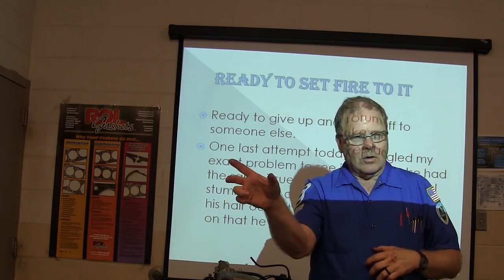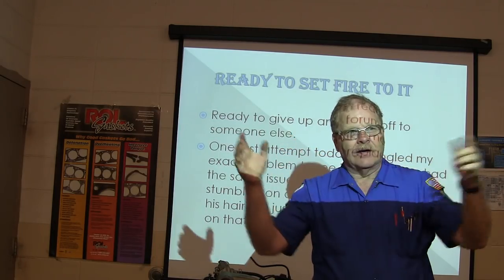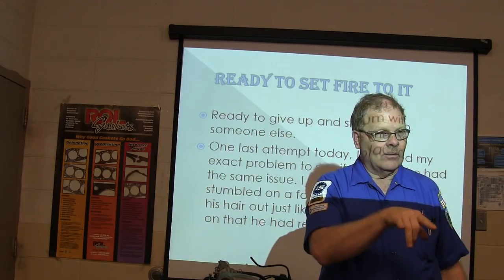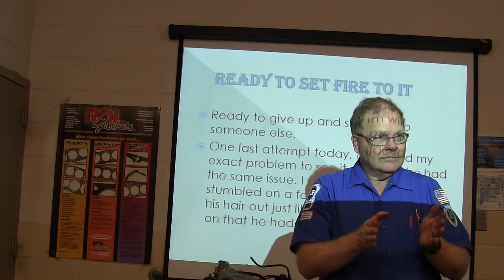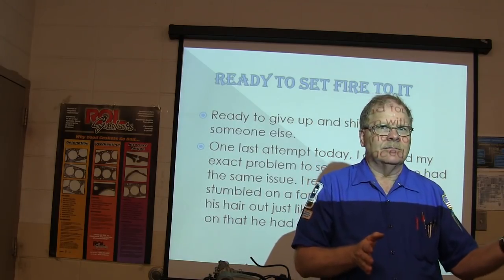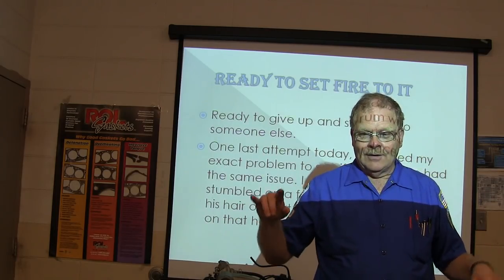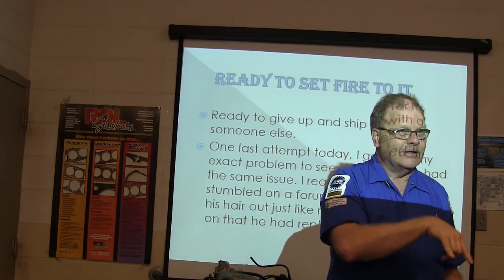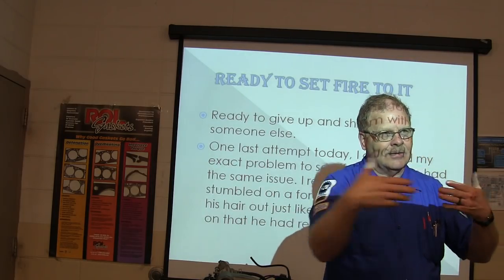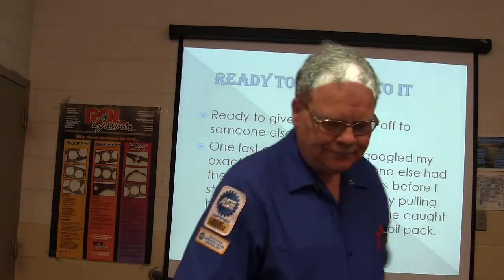Okay, so these two aren't firing coil 1 and 2, are they? Mm-hmm. Yeah, they're firing probably 1 and 6. See, it's got 3 coils. The middle one may be firing 3 and 4, maybe, I don't know. And the one in the back may be firing maybe 2 and 5. But you might just think, just looking at it, it'll be firing these two, and these two. Uh-uh. No way, man. It's got to be firing companions. So that means there are going to be these laminated strips going down the inside, routed on that.